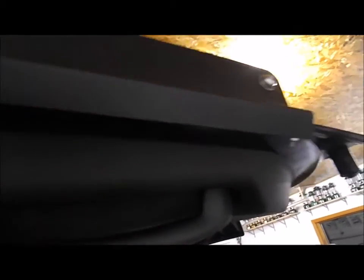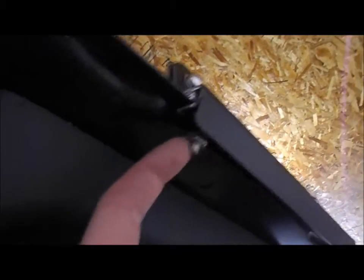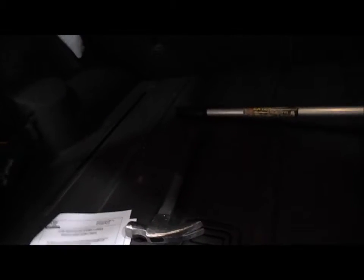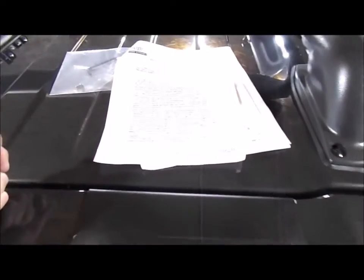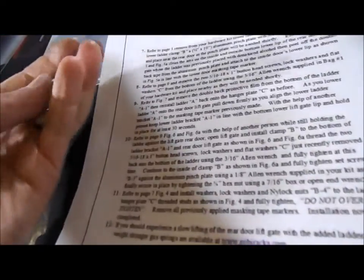The next part is to mount the button bolts, tighten them down, then run the set screws up against the pinch plate and tighten this nut — it's a 7/16 wrench size — so it's snug. This is something you're going to want to keep your eye on. I'm not sure if that hardware is stainless. According to the directions, the last step is to install washers, lock washers, and nylock nuts to the ladder hanger plate.